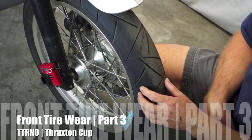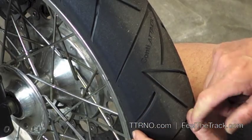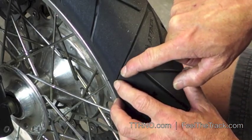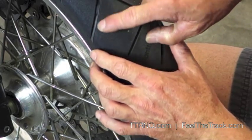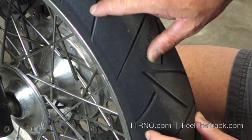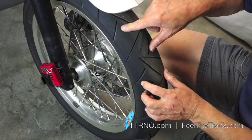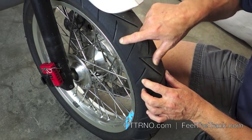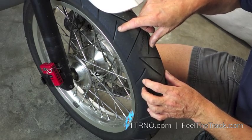If we look carefully at tire wear, the leading edge here all the way from the edge of the tire into the middle of the tire on every piece of tread pattern is way rounded and also lower than the edge behind it. That tells us that in the middle of the corner and when trail braking, rebound is far too fast, which means the bike is going to give chatter.